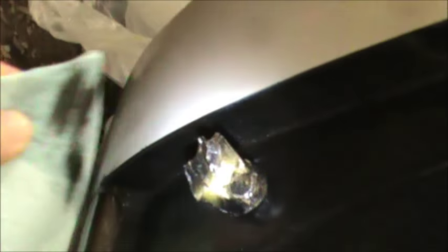What I was trying to do with this stuff was to cover up the blue streak that was down through here. I'm going to just try to take a little bit of mineral spirits and kind of wipe over these areas that have run a little bit - there's one pretty good run right there. You don't want to wipe too hard because you take a chance of wiping too much off. I'm going to say this stuff is still fairly damp. Mineral spirits should not hurt the clear coat at all.